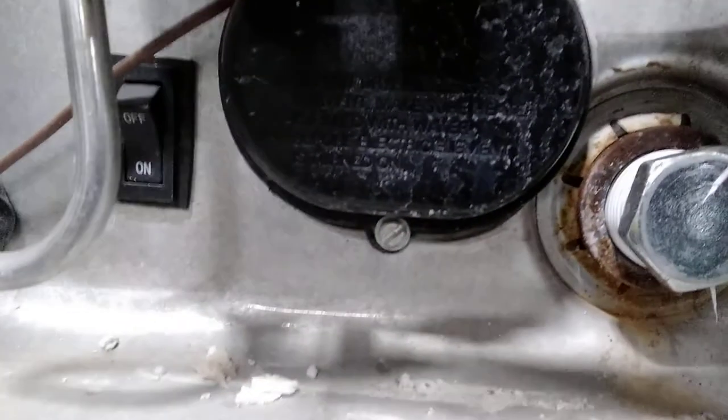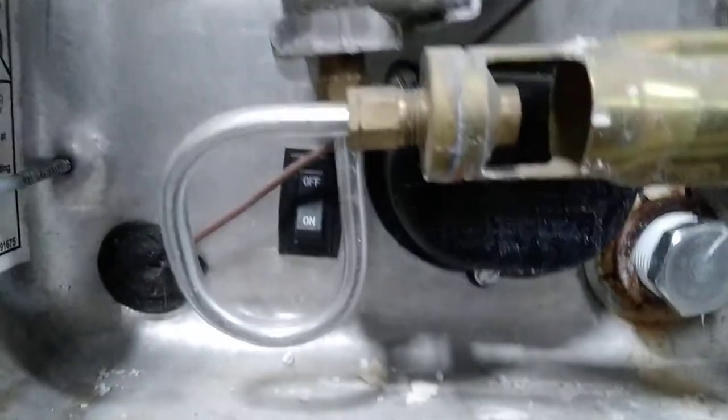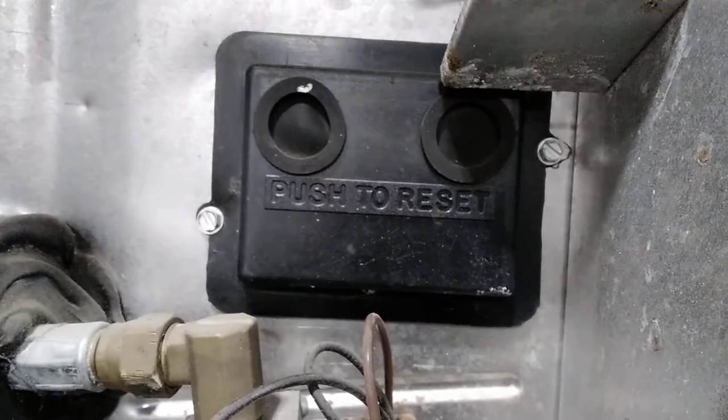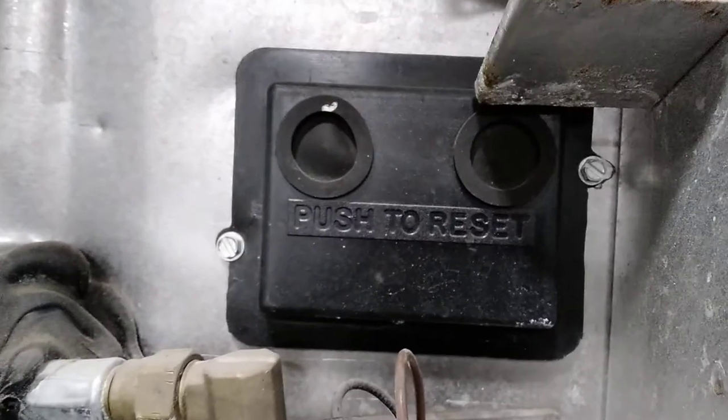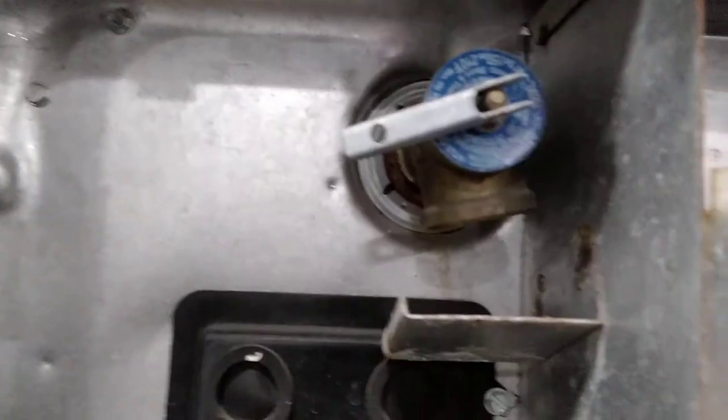Above this, we have our water heater. Does not have a hinge, it has pins, so tip it out, lift it off. Anode plug and drain. Under the black cover is your 110 heating element. And the electric switch here is for electric hot water. Keep that off, unless you know there's water in it and you're using it. Your gas valve, your T-stats are under here, under those buttons. If they overheat or trip, they will pop out. You push them back in to release them, reset them.